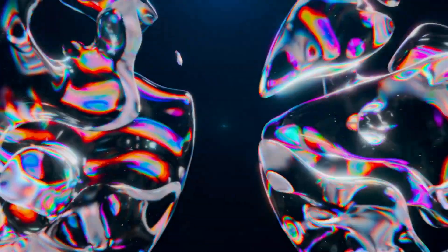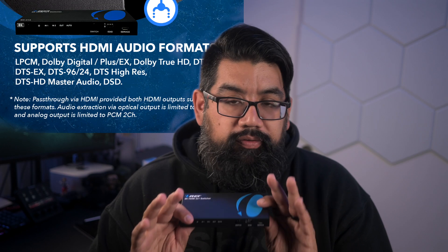Another detail about this is that it does allow all Dolby formats. You get a full official list, but for what I use — Dolby Vision — it works perfectly fine. And there's no lag to the video feed, which matters because if you're a true gamer, lag is bad. Lag gets you killed in Call of Duty. Because it's an 8K switch, it actually can go up to 8K at 30fps, so for current gen console players, your 4K 120 refresh rate is nothing but net in this. The only caveat is it's not HDCP compliant, so you are going to run into issues if you are trying to stream Netflix or something like that — it won't work.